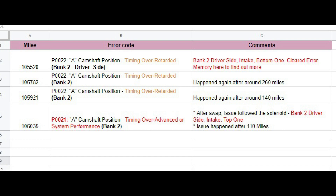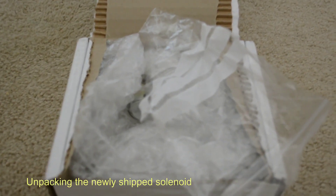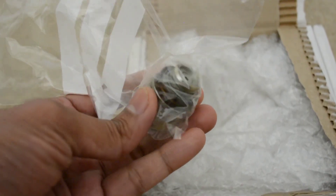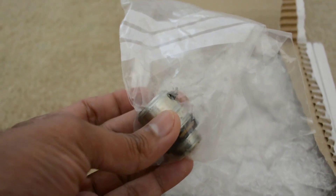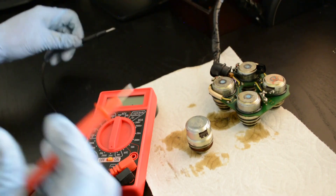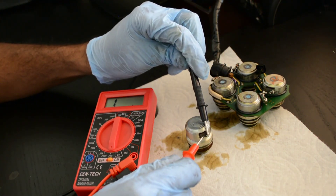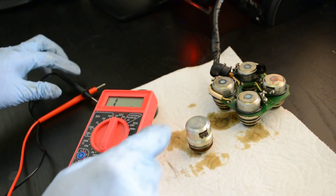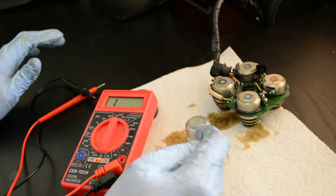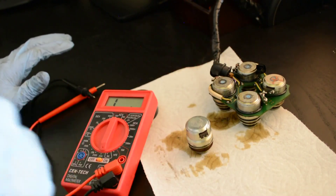At that point I decided to purchase a new solenoid. Opening the pack — there's the single solenoid. These are super expensive and you will not get a new one separately. Let me test its resistance — it reads between 4 and 4.5 ohms. All I have to do is transplant the o-rings. Actually these have new o-rings so I'll just transplant those. I'll swap the solenoid into the correct position — let's do some soldering.